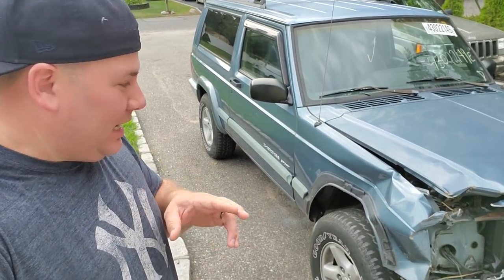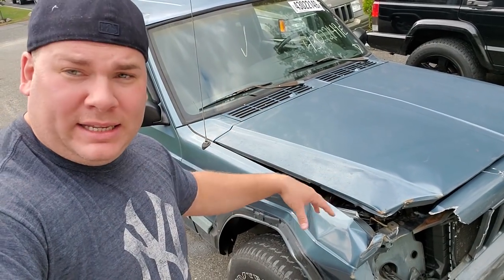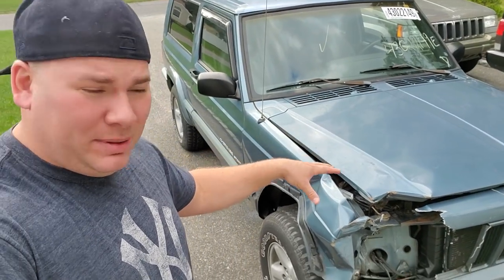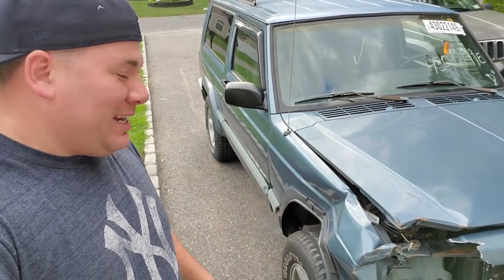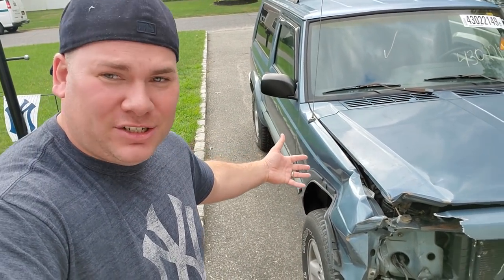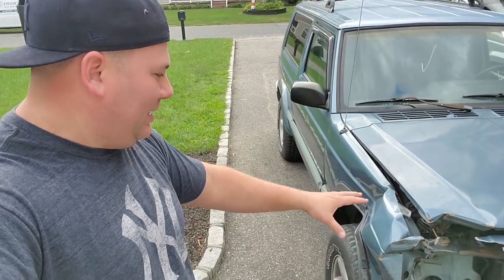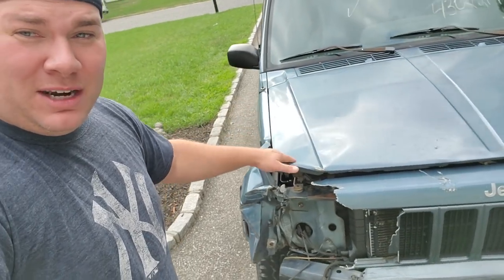Bleepin' Jeep has a great video - Tyler. He cuts out the unibody, drills out the spot welds, gets another interior piece, another engine bay piece, and just re-welds it in, and then he fixes his Comanche. And oddly enough, this stuff hasn't changed in 20 years, from '84 to whatever. The unibody's the same. So I can fix this - I've done it before.